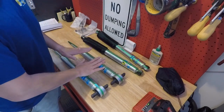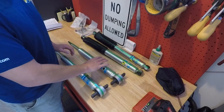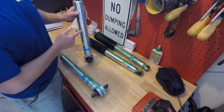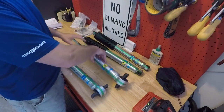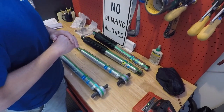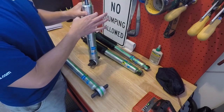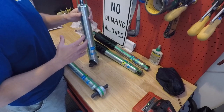What you see here is two new rear shocks and two new front shocks — basically struts. The cool thing Bilstein has done is create a leveling kit with different levels of spring perch position. I'm going to move the snap ring up when I install these, giving about just over two inches of travel. Instead of using a spacer on top of the strut, you pull the old shock out, reuse the OEM spring and spring perch, move the snap ring up so the spring sits higher on the shock, therefore raising the entire truck. The whole system is designed for that height.